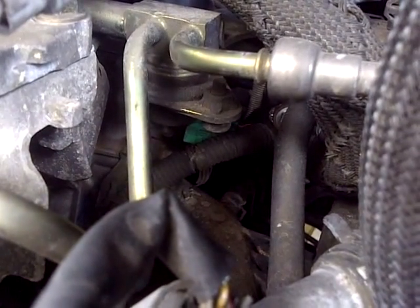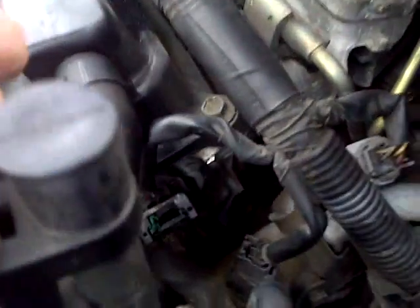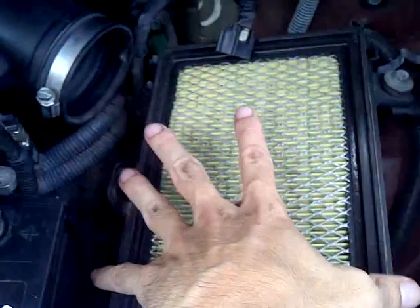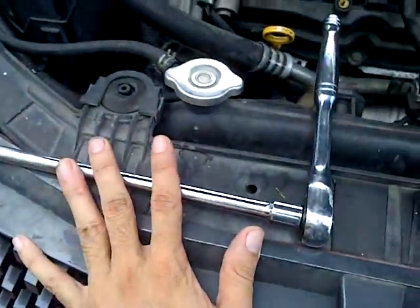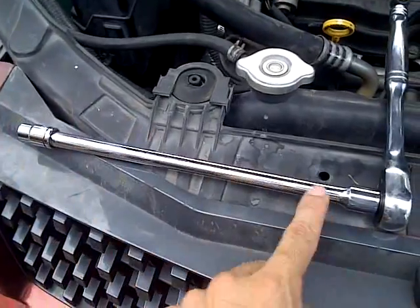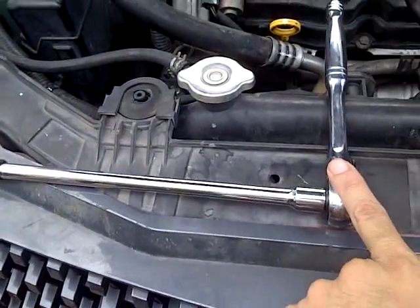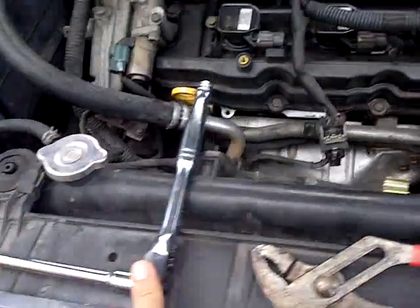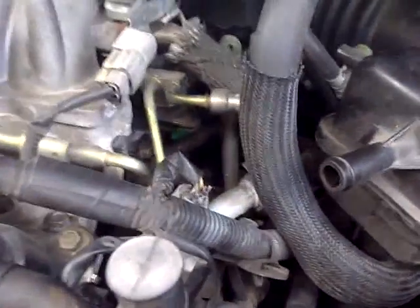Basically the left front camshaft sensor has gone out, and I have a feeling this other camshaft position sensor is probably going to go out too, so I'm going to replace it now even though it's really hard to get to. I went ahead and removed the air filter, and I'm using my mechanic's toolkit — a 10 millimeter socket with an extension on a 3/8 drive — which is still paying for itself.